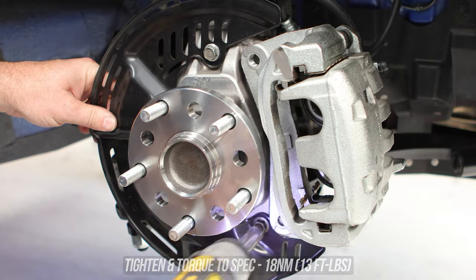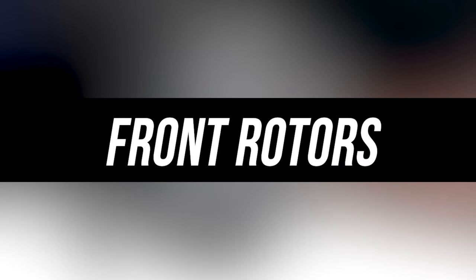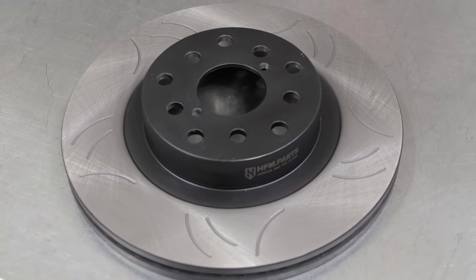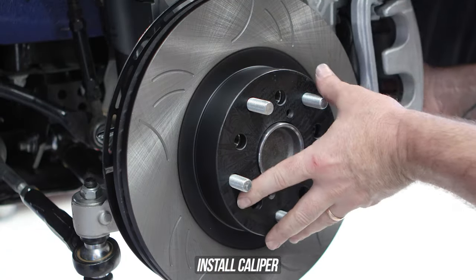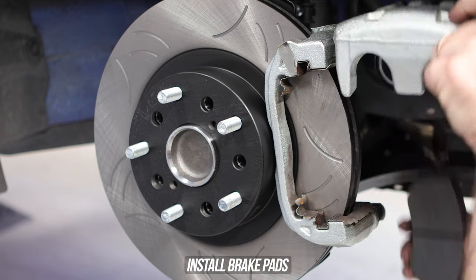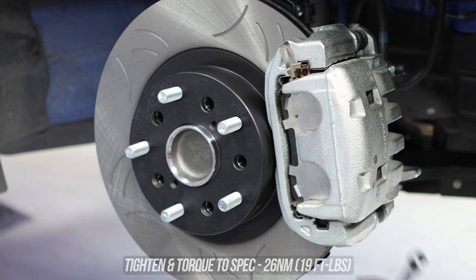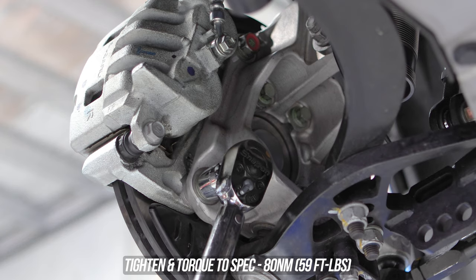Now that the back end gear is tight, remove the two main caliper bolts to accommodate for the rotor, which brings us to the front rotor segment. Since everyone's setup is different, check the website product page for what's offered for your setup. In our case we have a custom rotor that suits standard brakes, so we remove the caliper and throw the rotor on, winding on the two main caliper bolts by hand for now. Don't forget that you took the front brake pads out earlier — remove the bottom caliper bolt, lift the lid, put your brake pads back in, drop the caliper down, bolt it in, and torque to specs. Tighten and torque the caliper bolts to the final specs on screen — the front is done.